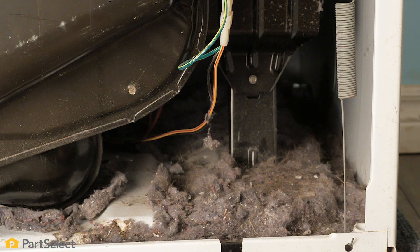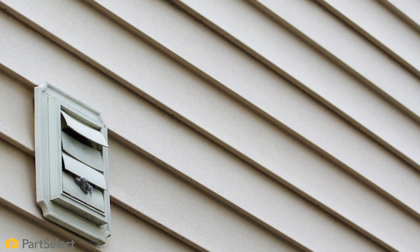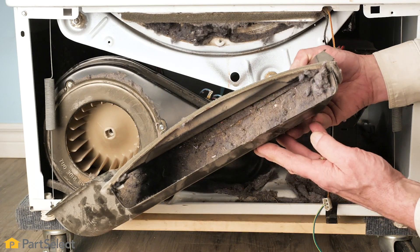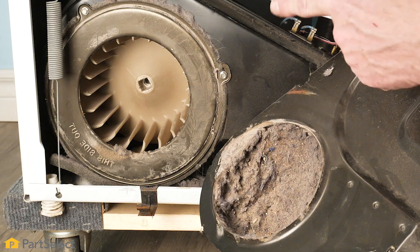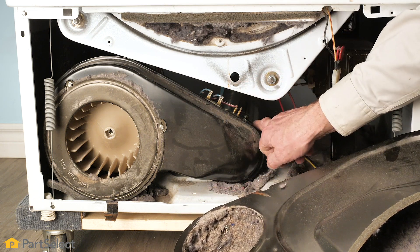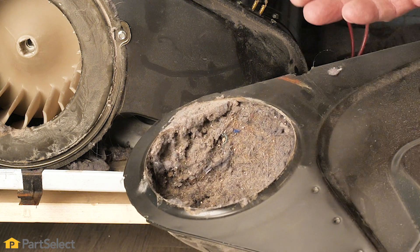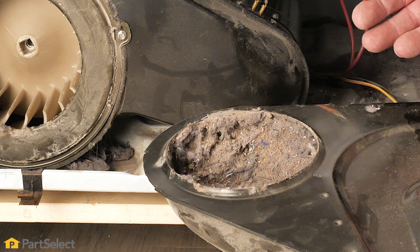As we mentioned, all dryers produce lint. Depending on how efficient your venting system is, that will typically dictate how much of that lint gets exited out of the house and away from the dryer. We'll next remove the outlet duct assembly so that you can see how much lint is in behind that area as well. Looking down into this outlet duct assembly, you can see the amount of lint built up here as well as where it connects to the blower fan. Our dryers work by sucking air through the drum and then exiting it out through a vent pipe to the exterior of your home. When we get a buildup of lint in this area, that restricts the amount of airflow — lint will not stay in suspension in the air and will actually tend to accumulate that much faster. It also decreases the efficiency of your dryer, resulting in longer dry times and therefore more energy use.